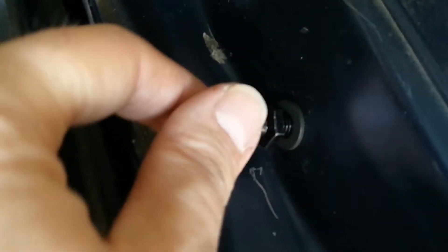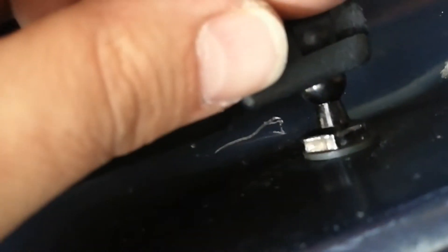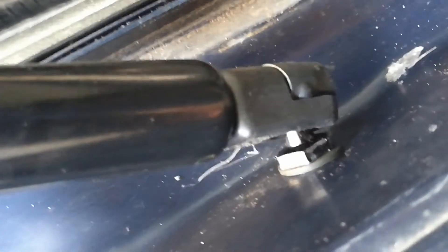The new ones thread right in, the same thread as the vehicle. With these, you're able to tighten them with a half-inch deep socket. Once you've got that in nice and tight with a half-inch deep socket or an open-ended wrench, these — because they have the retaining clip — should just pop right in. You just push them in. Just like that, it's on. Locked in.